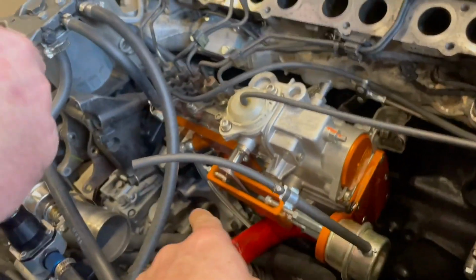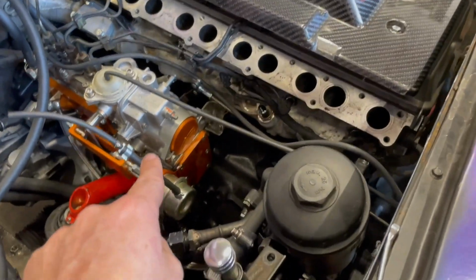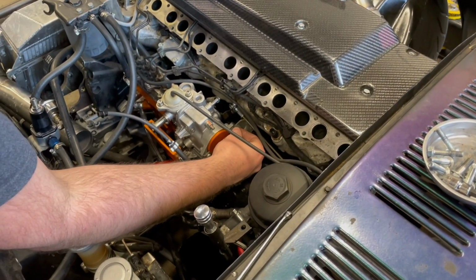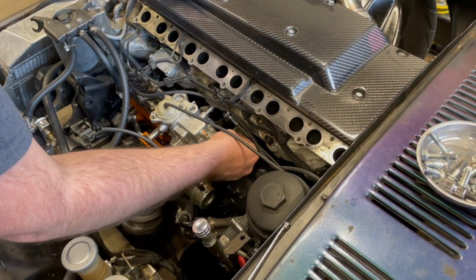So this cover's going back on because you see the giant puddle of oil. This is due to the anti-jerk filling this up with oil. And we would have to disable that to try to mess with this, but right now it's manageable with the amount of jerk that it has, and we'd rather tune out some of the low-end fueling. So we're gonna do that. So we've adjusted the off-boost fuel down a little bit.